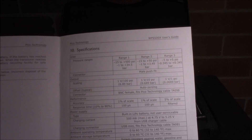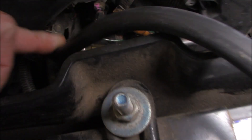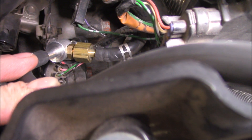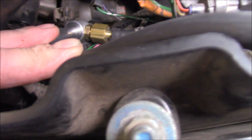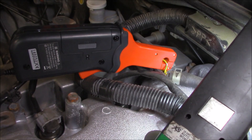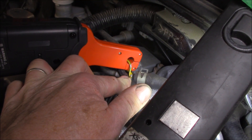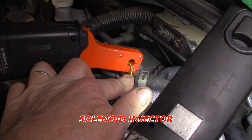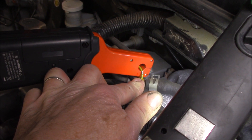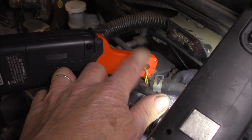And then I'll try and use current as a trigger. I've got my WPS hooked up into a T-piece going onto my return line onto my high-pressure fuel pump, before it heads back to the tank. I've also hooked up a current clamp because I want to be able to trigger it and see what number four is doing. Now, there are two wires going onto the injector. Which one is correct? It doesn't matter — if you get the wrong wire, all it's going to do is read it upside down, so just flip your clamp over and it will read the right way. Current is the same on either wire; one will be a positive and one will be a negative. It's a complete circuit.